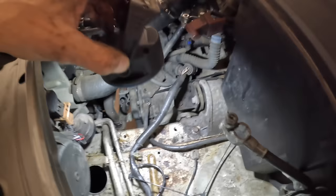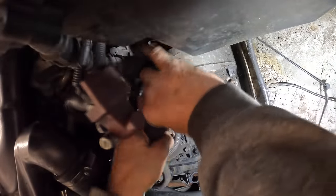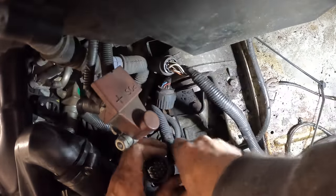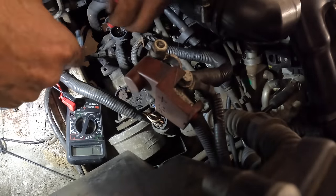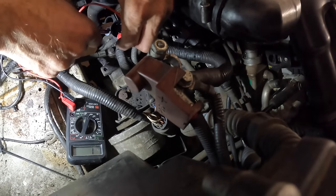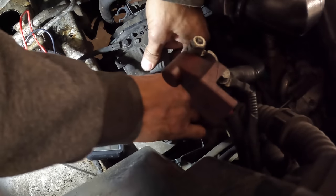Now we've got access to those drums. Here is the cable that goes down to the gearbox and its internal solenoids - it unscrews one drum into the other, and there are the pins we need to test. Using information from the MG Rover supplies website, you need to touch pins 16 and 18. I should get a result, but I'm getting nothing on the ohmmeter from that sensor, so I'll plug this back in and carry on with what I thought was the problem.